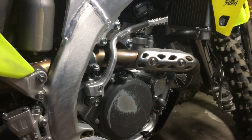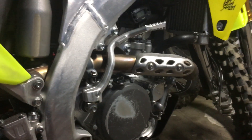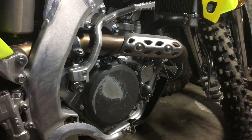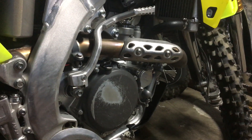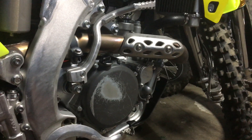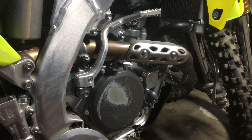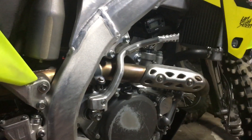This way works with clutch plates that aren't actually worn. So you might get into the clutch and find out that the clutch plates and clutch fibers aren't actually worn. Some ways to tell if clutch plates are worn is discoloration of them, and for your fibers you normally measure them. If you look into your manual and you've got genuine plates, you will be able to get specifications for them.